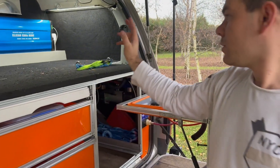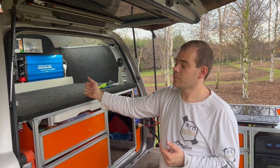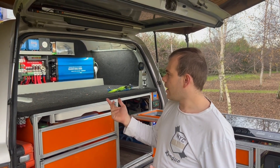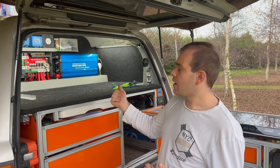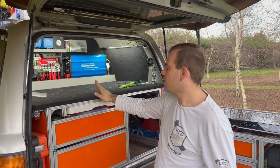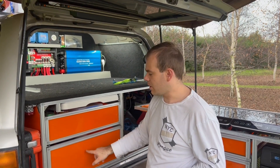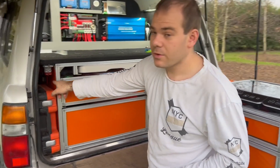The PowerHub can have two DC-DC chargers connected to it, and you can have three solar controllers or AC controllers. Or if you only had one DC-DC charger, you can have four solar controllers or AC chargers. You get power in from the start battery and also just wire in your auxiliary battery bank to it. I currently have 480 amp hours of lithium in my battery bank — a 250 amp hour battery behind here, and another 230 in there.